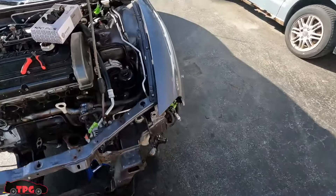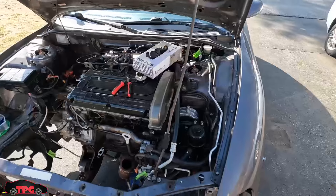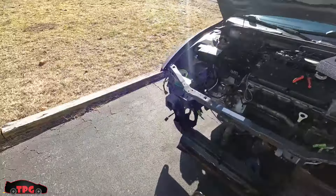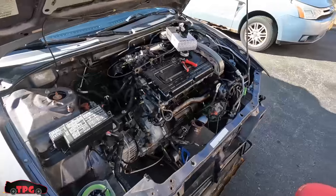We're going to pull the power steering reservoir, delete the ABS module, delete ABS altogether, install new front lines, a new proportioning valve back there. We're powder coating a ton of parts, sandblasting a ton of parts, fixing and fabbing some stuff.